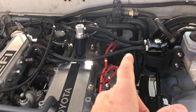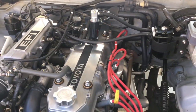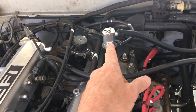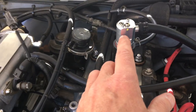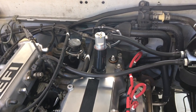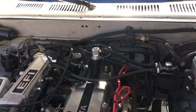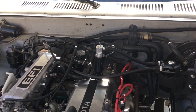I've been struggling back and forth with the catch can issue, and it's very difficult to sort out exactly what's going on. I think part of my problem was I had my dual channel PCV valve adjusted incorrectly. For a while, the cruise circuit was not activating at the proper time — in fact, it wasn't activating at all. I inadvertently had gotten so far off the map with my adjustments that I was running a fixed orifice PCV valve.